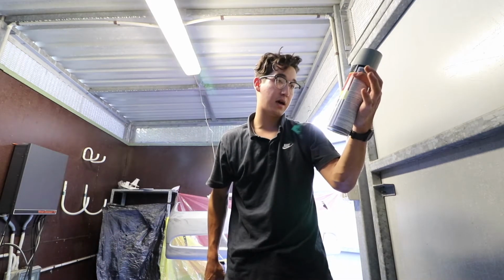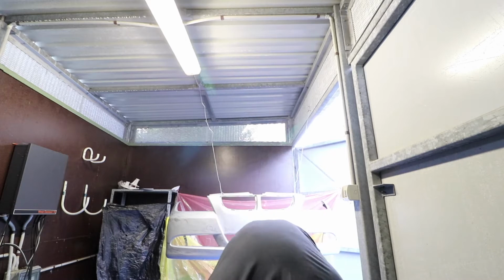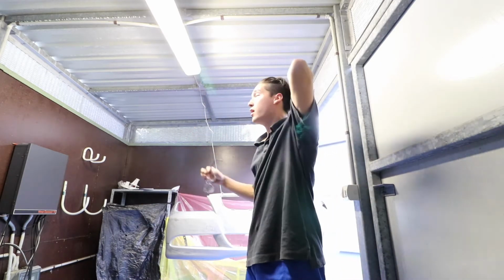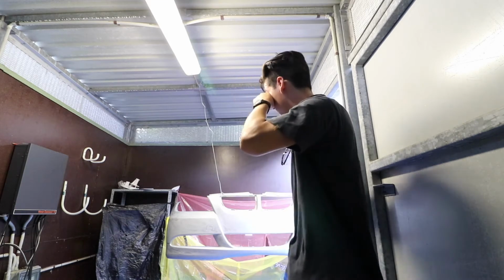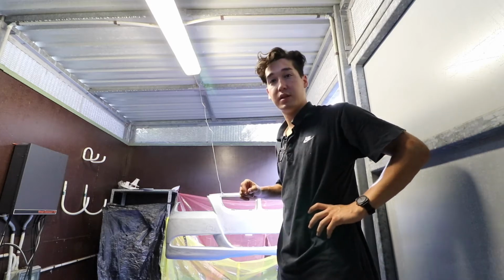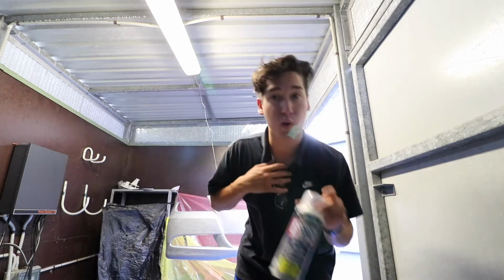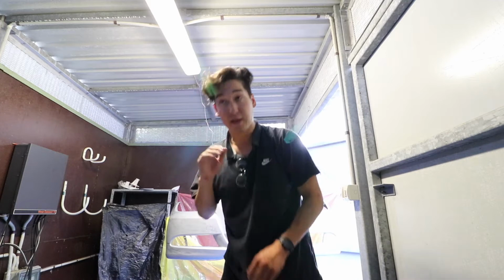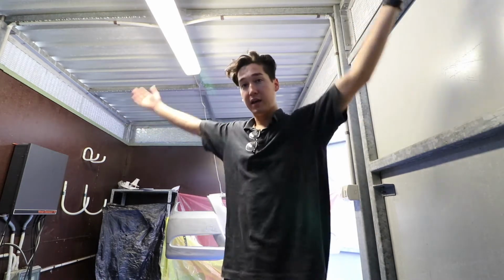And then with any paint job, you obviously need primer. That's my coat of primer I'll put on first. And then, sorry, this one was my clear coat. And then these are the 2 matched. So that's great. So the game plan is primer on first. Nice, even, light layer of primer. Sand that down with the 800 and then the 2000, and then back over that with the correct paint that we bought. Then sand that down 800 to 2000, and then back on with the clear coat, 800 to 2000, and then we're done. Yay! And then I'll let it dry overnight.